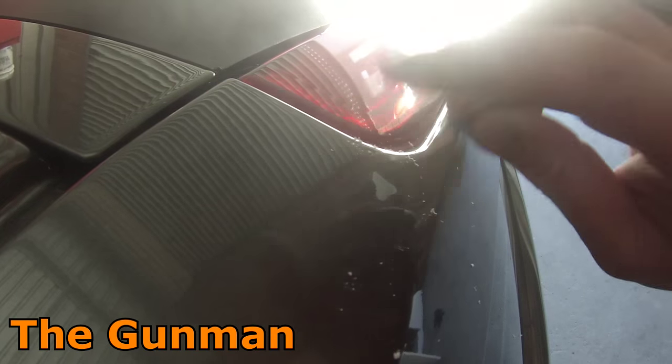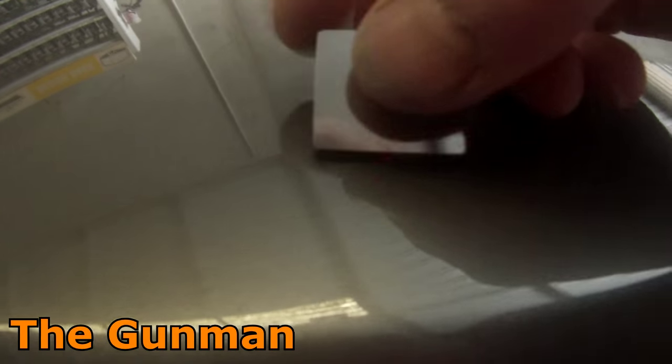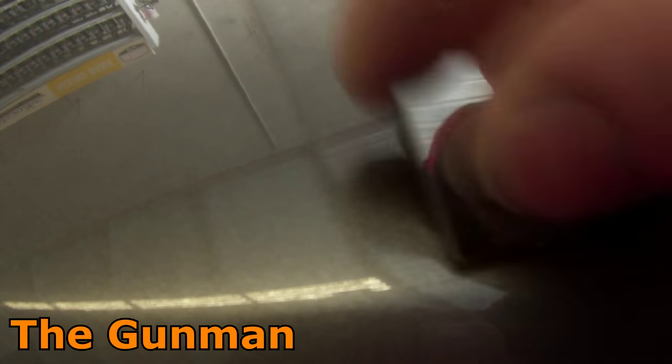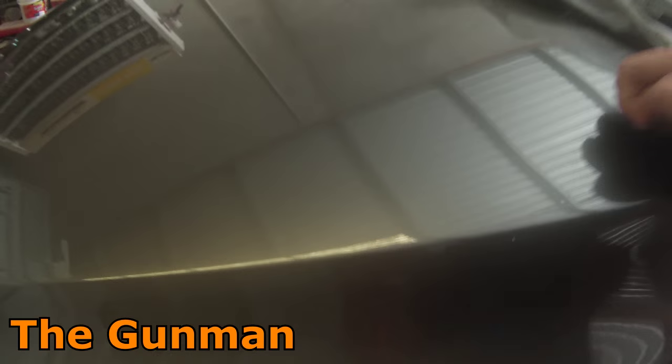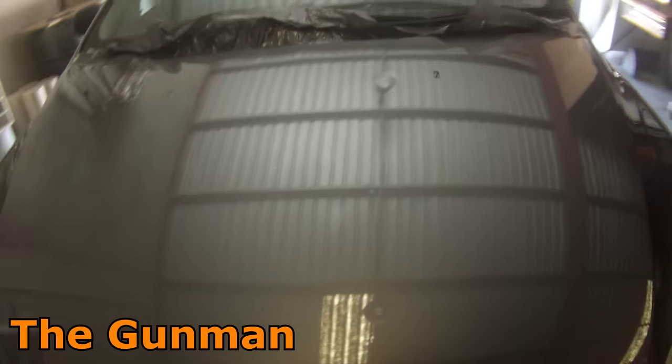This is by far not the only method of removing runs. You could use razor blades, or my little trick of putting body filler over the top and then hitting it with coarser sandpaper. You just have to decide based on the size and position of the run, and that will determine the method you use. This one was small so I decided to just use the tungsten block.